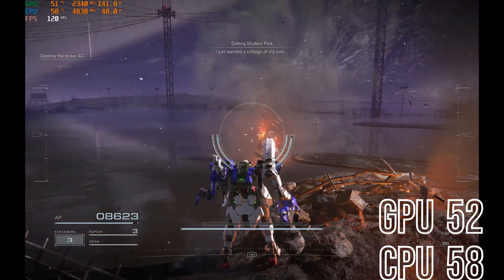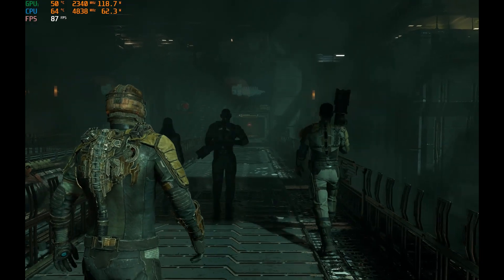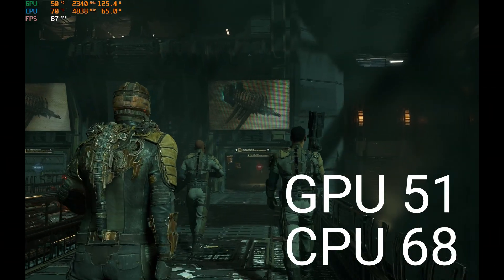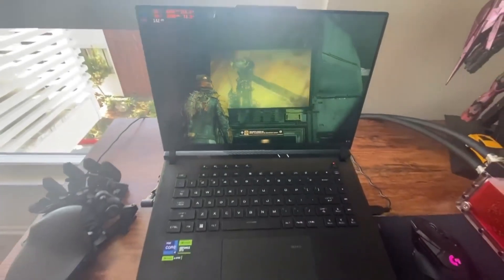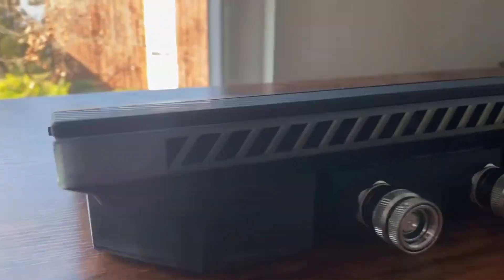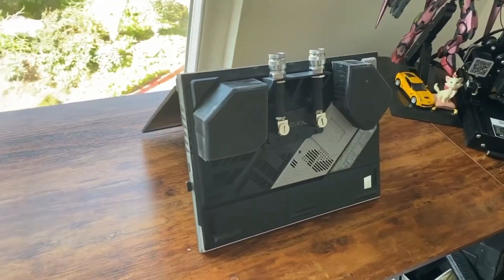As it is now, I'm stoked about this. There's no danger of bursting a pipe and ruining your air cooling, no bursting a pipe and hurting yourself — it is just cut out a rectangle sized for the RAM block, print out a case spacer, and slap it on there. I'm using Upsiren Pro thermal putty right now and it's getting a 30-degree difference in these games. On Dead Space, the air cooling was thermal throttling at 96 degrees, but with water cooling it's down to 66 degrees — a massive difference. Hopefully with a bit more ventilation added via revised case spacers on the bottom it'll make air cooling even better. And again, fully removable — unlike before where it was soldered and you'd need a new heatsink to replace it, it takes exactly as much time as pulling the bottom cover off to repaste. Beyond stoked at how much safer it is, and it actually works better than the other version as well.